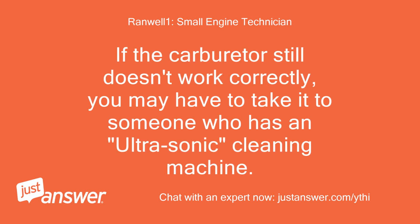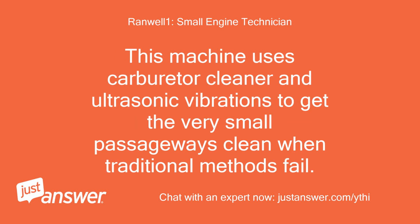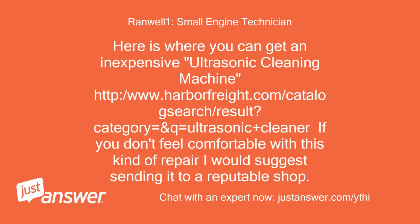If the carburetor still doesn't work correctly, you may have to take it to someone who has an ultrasonic cleaning machine. This machine uses carburetor cleaner and ultrasonic vibrations to get the very small passageways clean when traditional methods fail. Here is where you can get an inexpensive ultrasonic cleaning machine: harborfreight.com. If you don't feel comfortable with this kind of repair, I would suggest sending it to a reputable shop.